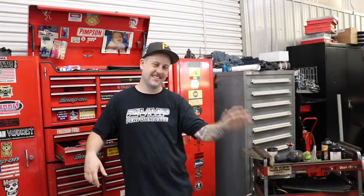We are at VMP Performance and we're gonna get the fuel system installed on the car — hopefully bring it back to life. We have Jesse here, he's gonna be installing the fuel system. Professional diagnosis given the information: fuel pump fuse is good, fuses are good, intermittently running — sounds like the pump just doesn't care to live anymore. Ford problems. But we'll be ready to make a lot more power now.